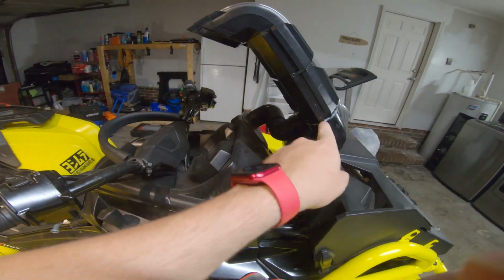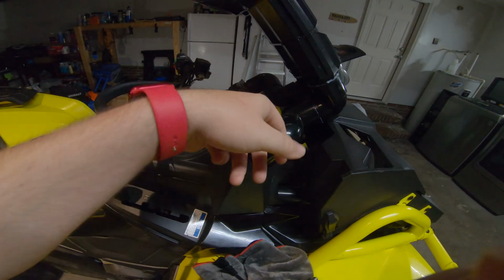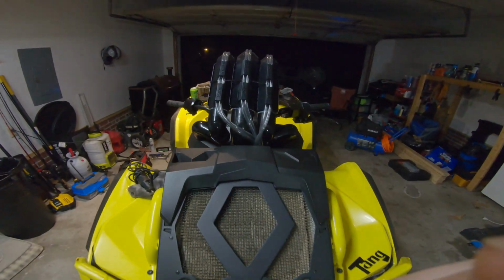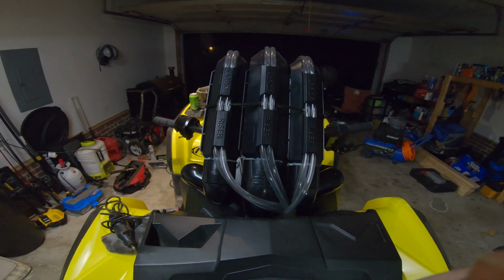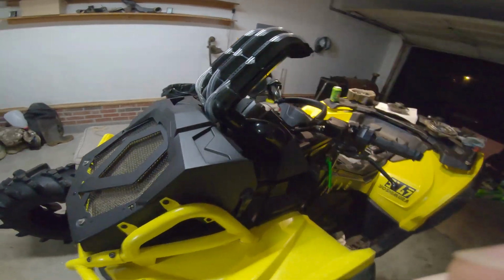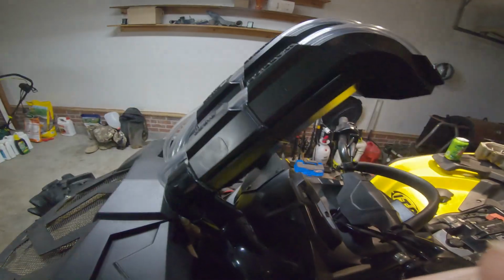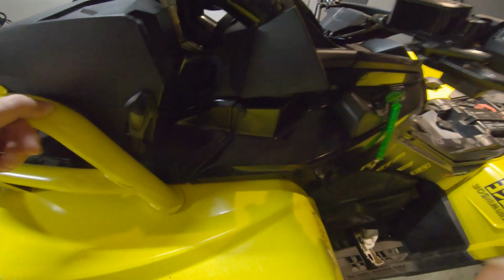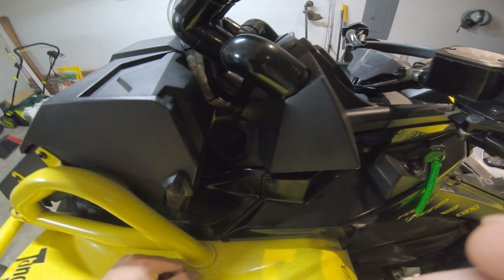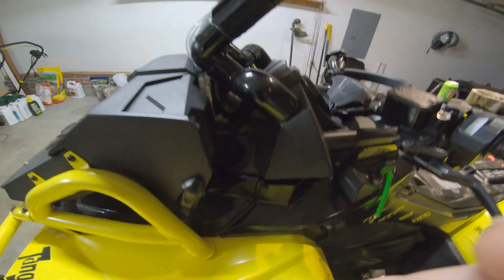They tell you to put silicone here and here, and when I did that, of course it tried to bend and twist and it just didn't want to stay in place, which is why it came out a little bit crooked. Everything ended up shifting to the right once the risers got completely secured on there. I did put one zip tie around the middle. The kit comes with like 4, and I'm not sure what they're used for other than that, so I put one there. I did end up putting a push tab pin right here because this kept trying to pop up when we were hitting bumps. Other than that, I pretty much showed you guys how to route it on the kit.